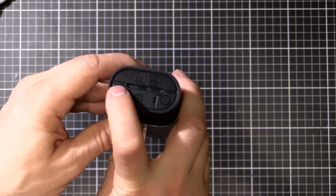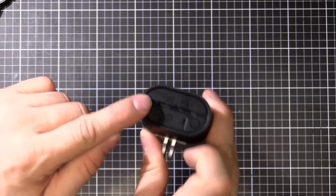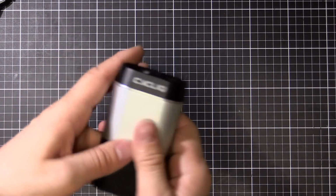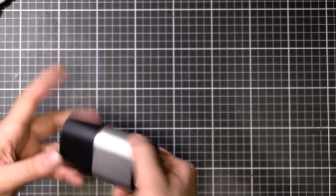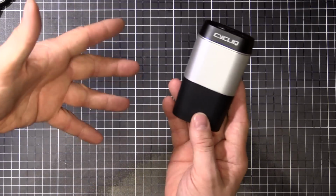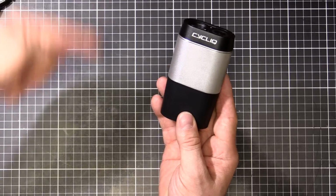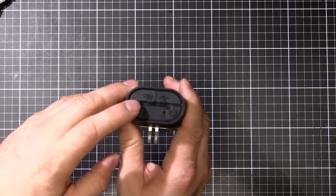If you press this button while you're riding, like you see something crazy on the road or an accident happens, it will save that video that it's just recording now and the one previous, so that way it won't record over. Because when it's recording and it reaches the end, the memory card's full, it goes back to the earliest video and starts overwriting from the start again. So it just keeps looping around and around. So you can actually save the video that you want.